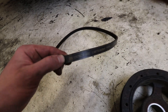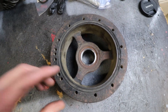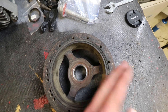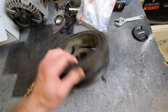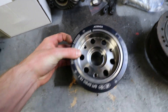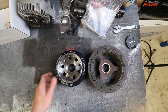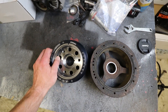I did notice that it is the factory GM one, so that's pretty neat. This thing is pretty wrecked. Over here where it's getting all smashed up, the inner is starting to push out and this side is getting expanded — that's where you'll get that wobble when that starts to happen. But we got the new Romac that I actually ordered from Texas Speed. Got here super quick. You can tell the size difference between the underdrive 25% reduction pulley and the stock one.